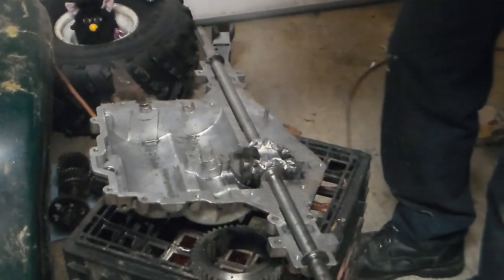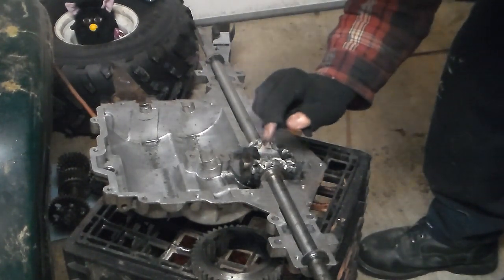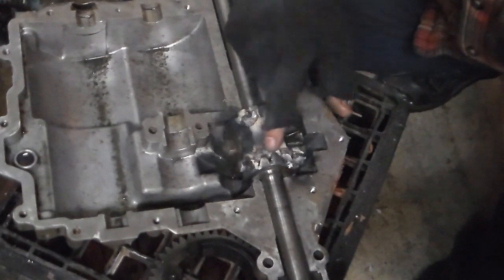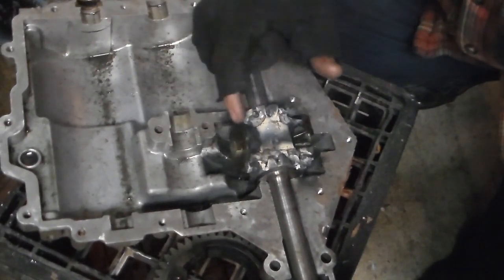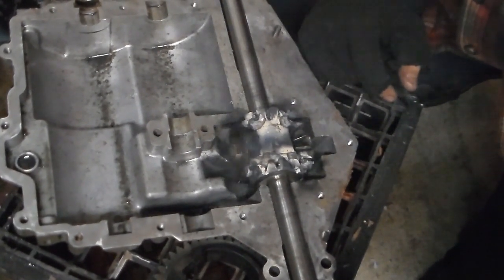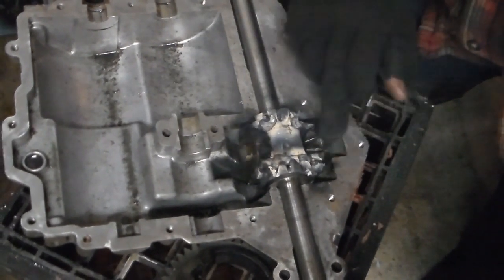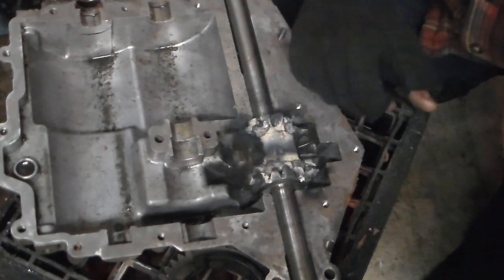So basically, you can see we're still steaming, and what I've done here — I'll post up a couple of pictures at the end of the video — is I've gone through and welded on the end of the piece of square steel, I've welded the ends on each side, so that you're locking to your outer gear through this, along with these pieces here. So essentially, we've created a locker like what you would install on a full-size vehicle. This gear is welded all the way across to this gear, and your center shaft is going through these, which are welded, plus the center piece of steel, binding everything totally together.